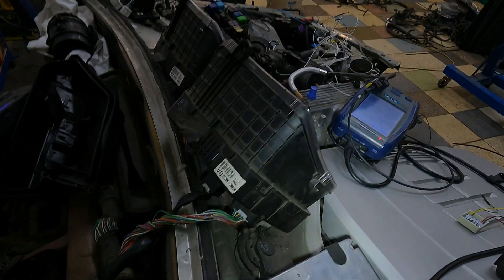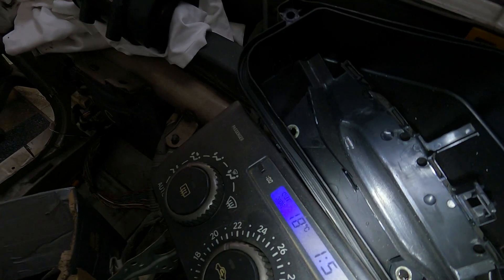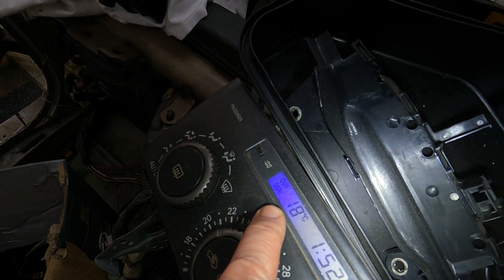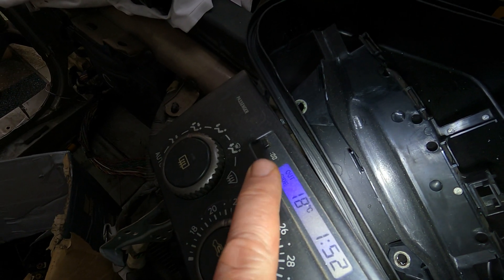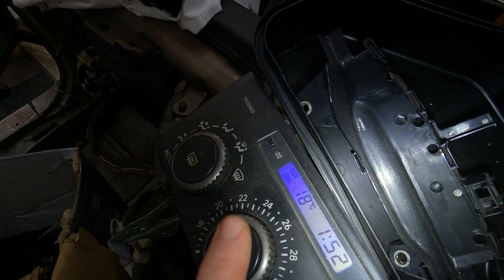You can hear the ECU beep into life, and you might be able to hear the humming of the drive-by-wire throttle as well. While we're here, we're going to go over the bits that make it plug and play. We've got the ambient temperature over there — the MPX device we're using is an analog device, it doesn't sense actual ambient temperature. 18 degrees is just there to keep a figure on screen; otherwise a little E would pop up, which would be annoying.